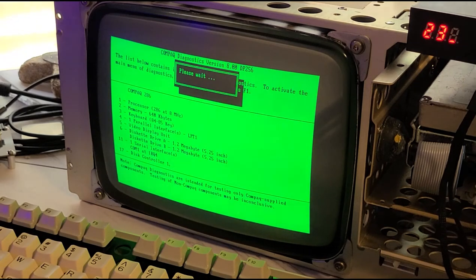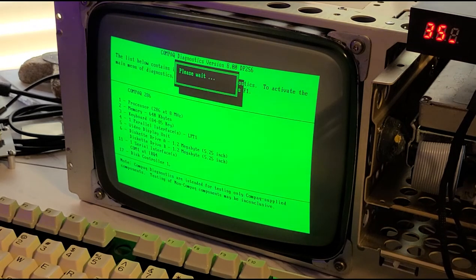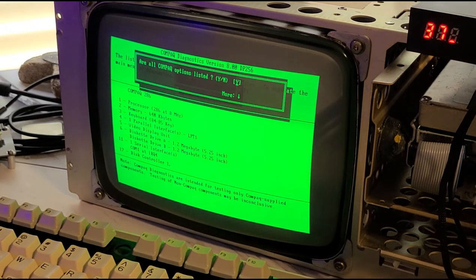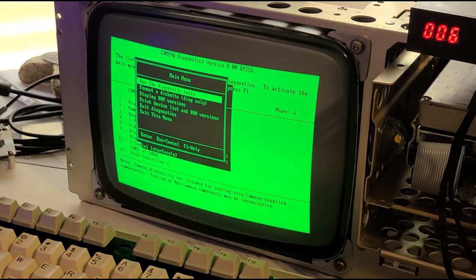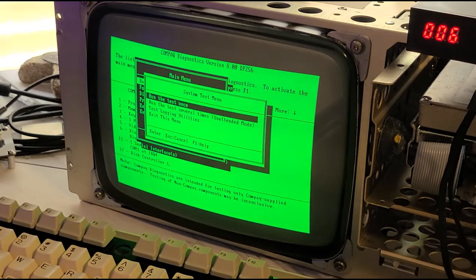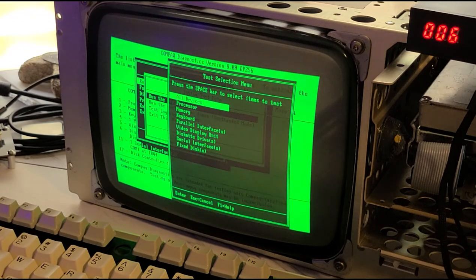Yeah, so here I'm setting the floppy disk drive for drive A, and what I should have selected here was 1.44 megabyte 3.5, because that's what the GoTek technically identifies itself as. But for some reason, I just kept going through and choosing the wrong thing. Sometime off camera, I eventually got it set right, as I found in the next clip, but I never did see actually where I did that or discovered that. But at any rate, 1.44 meg, 3.5 inch floppy would be the right setting for the GoTek.